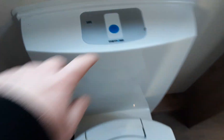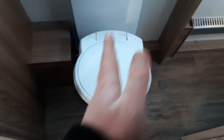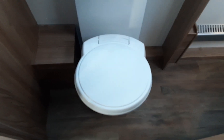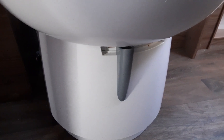In the bathroom you've got the toilet flush — the electric flush is here on the toilet. You've got the toilet full indicator light which will illuminate red when the toilet waste cassette is completely full. The toilet seat itself turns for your convenience. However, when you are removing the toilet waste cassette from underneath the caravan, you need to make sure the toilet is pointing straight on, as it will lock the cassette in place if not. Below the toilet you have the grey waste handle — push this into the open position to allow waste into the cassette, and have it in the closed position when you're not using the toilet or when removing the cassette from the side of the van.